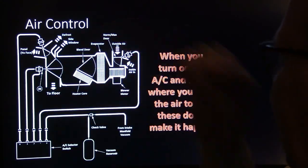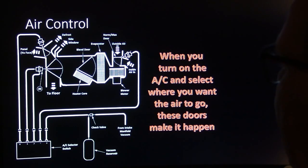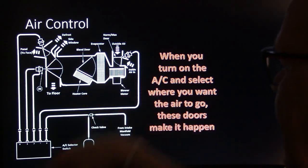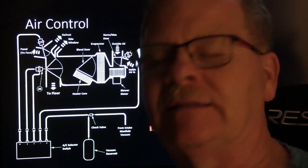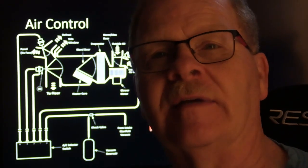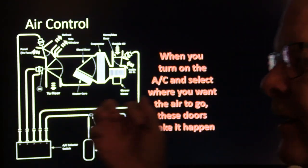When you turn it on max AC, you're basically using inside air only. You're re-air conditioning the inside air. That's why on a long trip, if you run your AC on max, you'll basically give yourself colder air with better fuel economy too, because you're not pulling in hot air from outside and air conditioning that as it comes in.